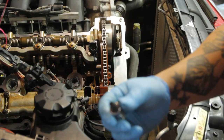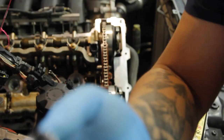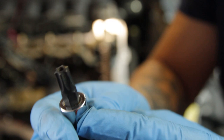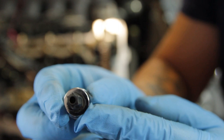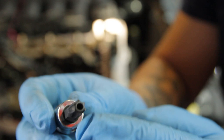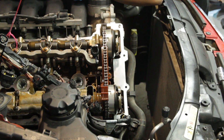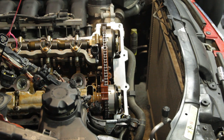Unfortunately I'm not going to be able to use the extended T45 socket because what's needed is a hole in the center for the stock bolts. My extended ones don't have this hole, so I'm going to have to remove them with this little stubby thing and hopefully get it to fit. The new bolts don't have the little center pin so they don't require the hole, and I could use the extended ones to properly torque those. This is going to be my access point right there. We're going to start removing them one at a time and replacing as we go — you only want to do one at a time because you don't want the sprocket to fall apart.